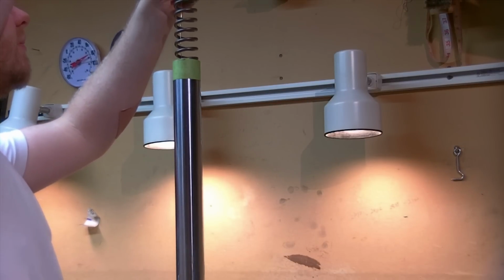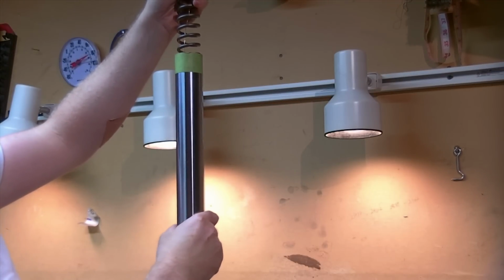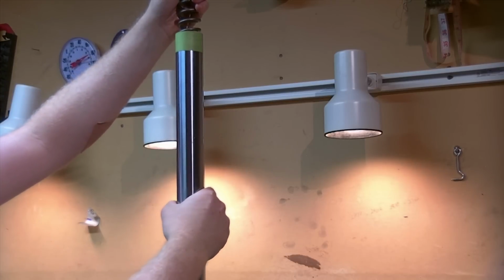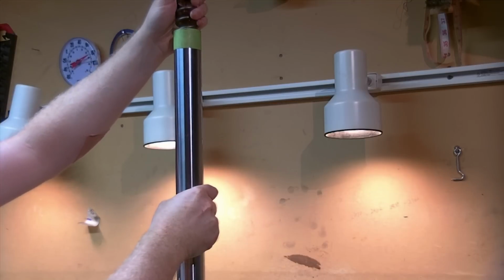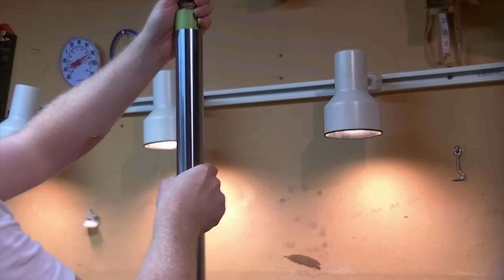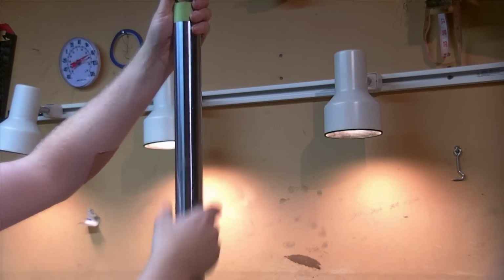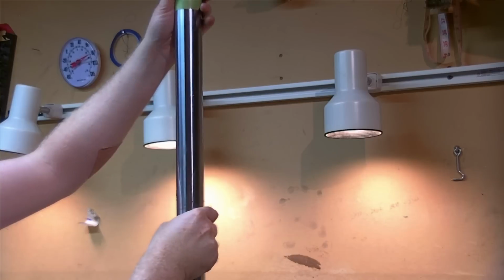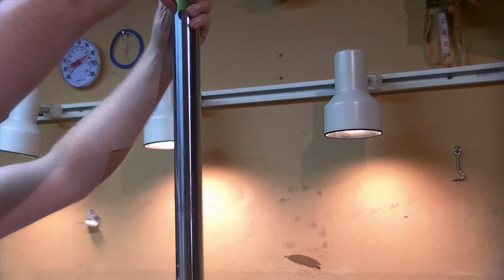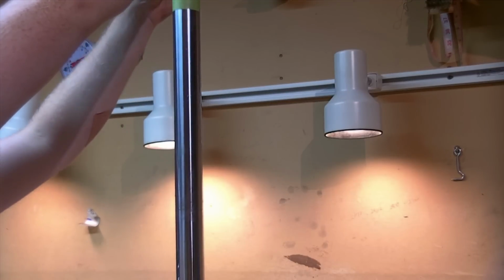Also keep an eye on the level. We may have to slide the inner tube up here this time to meet it so we don't overflow our fork oil as we are displacing it by putting the spring in here. So we need to have that extra height in our inner leg. Like just dropping it in, easy enough. Perfect. Fork's at full extension here.